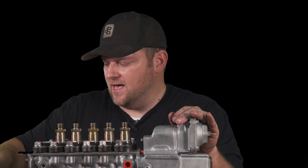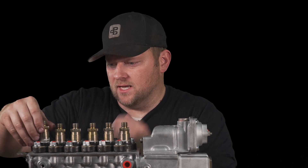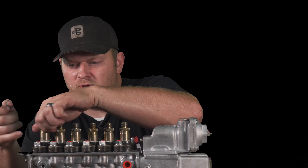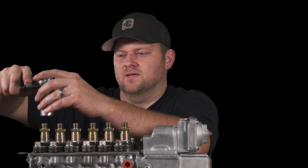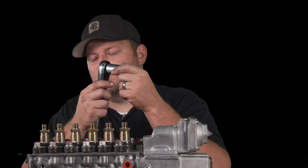Your delivery valve goes in and drops straight down like that. This spring goes right onto the top of the delivery valve in the middle and indexes. We want to put our new O-ring on there — lube it a little bit with some WD-40, engine oil, or even a tiny bit of grease. The initial torque spec is 25 foot-pounds, so just get it pretty good and firm. Move on to the next one, and when we get done we'll torque all of them with the torque wrench.